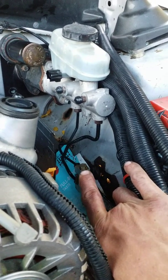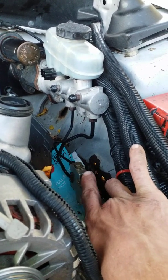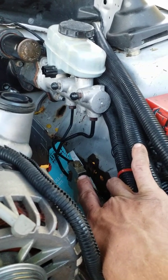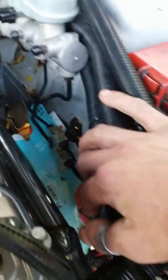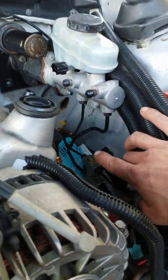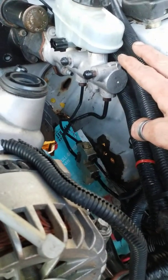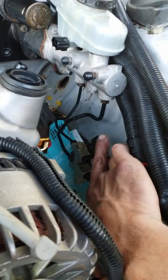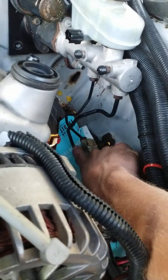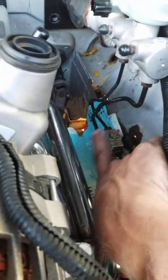With the 1999 to 2000 Mustangs with no ABS, they have the driver's side brake line coming out of the top fitting. On the 2001 to 2004 ABS models, these two lines are going to come over to your actual ABS system and then be re-split the same way as the 99 to 2000s. This hydro booster was originally installed on my 1999 V6 — I just ended up switching the whole project to this car. To remove this, you're going to need two size 13 millimeter hand wrenches.